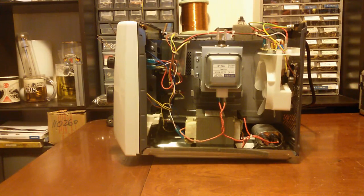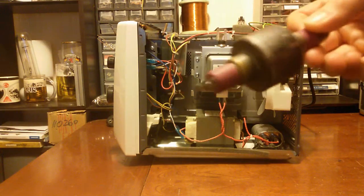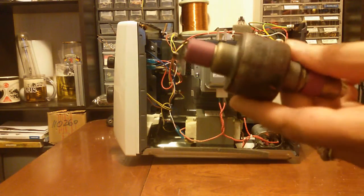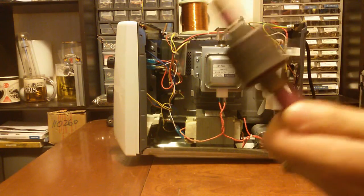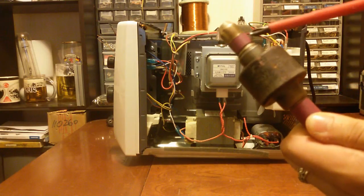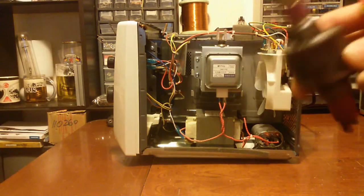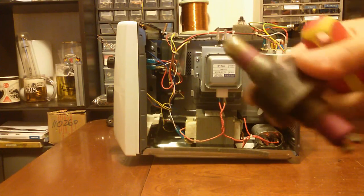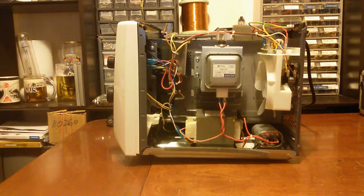And I will end up with one of these - that's inside, the internal part of the magnetron. But actually I want the cooling fins left on it, I don't want to take them off like I've done with this one. But one thing with magnetrons is that those parts here, the insulators, are toxic. Don't break them, don't grind them - extremely dangerous. Don't scratch them as well, very dangerous stuff. It's beryllium oxide ceramic, that's poisonous to breathe in if you get a powder or dust.